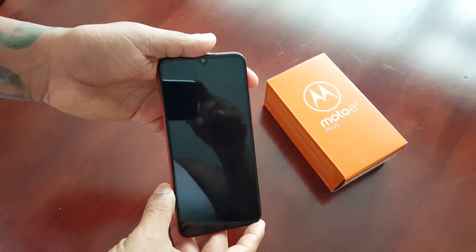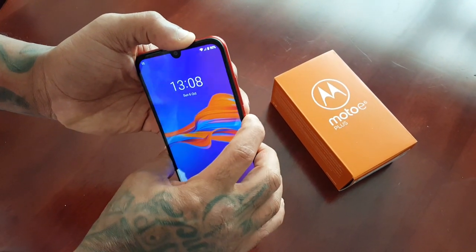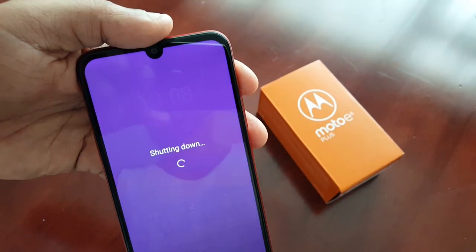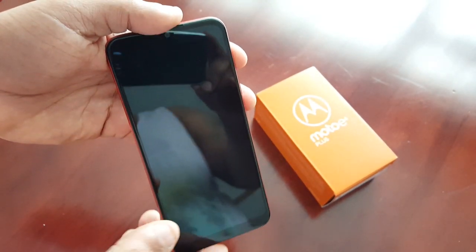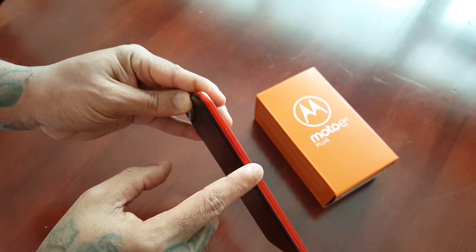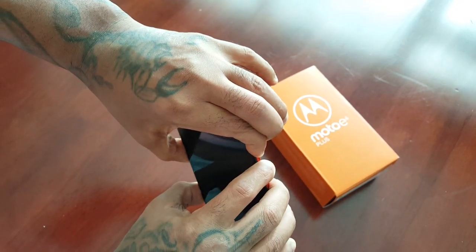So what you need to do is just power off the device, pressing the power button. So power off. And just wait for it to shut down. You should feel a vibration once it's shut down. And then you're going to press the volume down button and also the power button at the same time. So volume down and power button, keep them both held